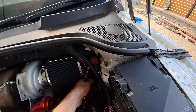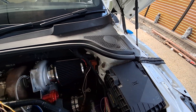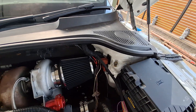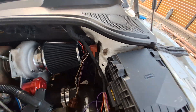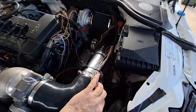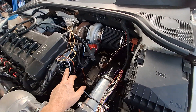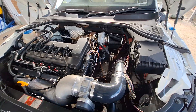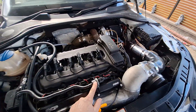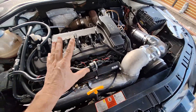I've tidied up the wiring here a bit more, still got a little more to do. The O2 sensors can be deleted — same as the rear O2 sensors — so I'm going to be chopping that wiring out and capping the ends with heat shrink and wrapping it all up so you'll never know they were there. I still have some wiring left to do for solenoids for VCT — variable valve timing — which at the moment is still controlled by the factory R32 ECU.